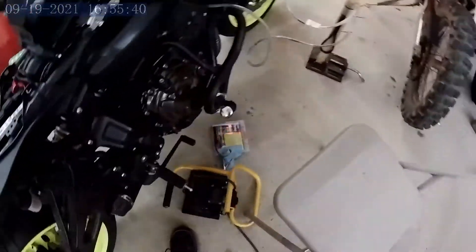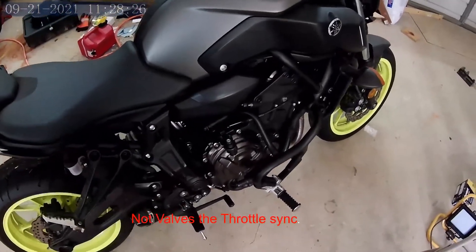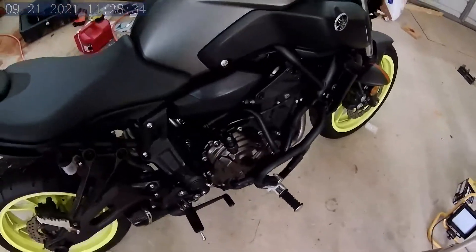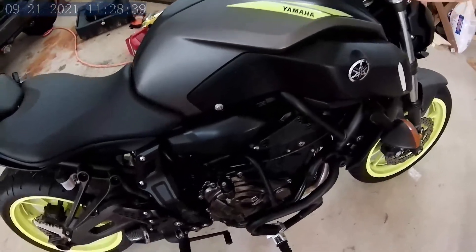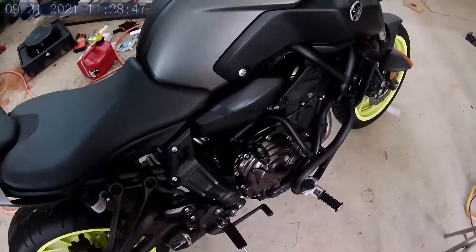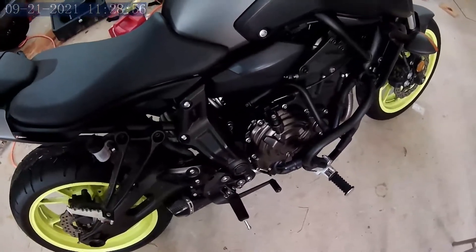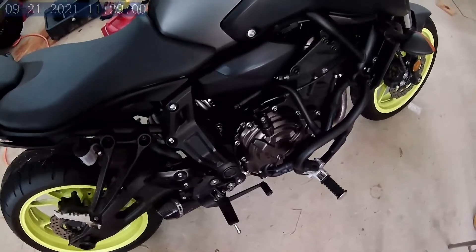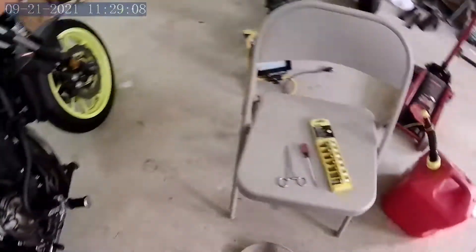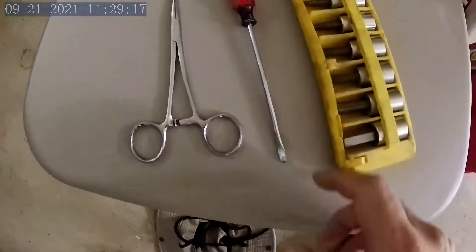I got the valve adjustment done and did a test ride, and I can tell you it made a huge difference in how smooth this engine performs. The throttle response was a little twitchy right as you'd come onto the throttle — a bit jerky with some hesitation. After adjusting the throttle sync, the throttle is super smooth and very linear. This bike has the stock ECU and all stock components — it really made this bike perform well. The vibration also seems a little less overall.